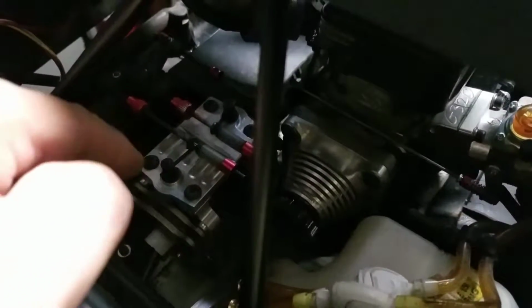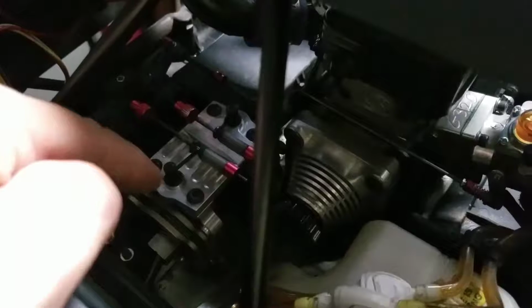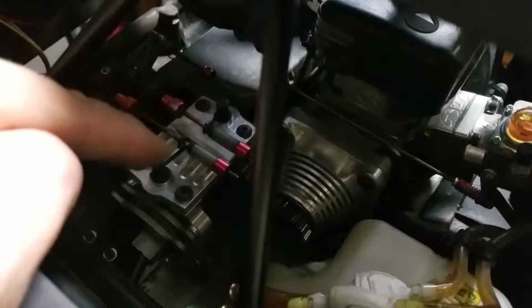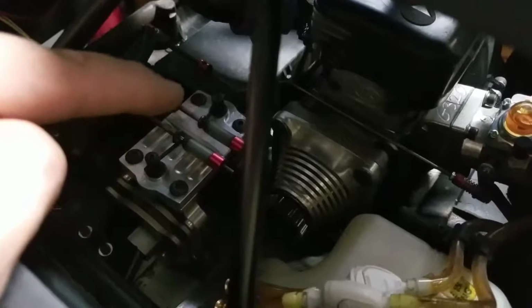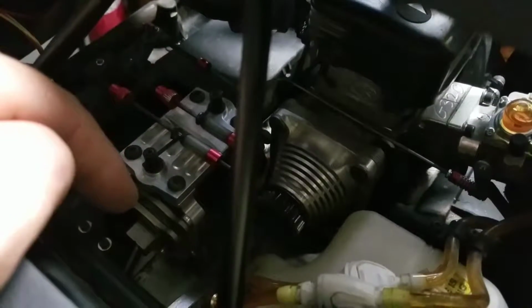In the factory setup, it would work fine, but mind you, these components are made for a Losi 5, Losi parts, not KM parts. And they base all of their design specs off of Losi parts. That's why aftermarket parts are said to be made for the Losi 5 and, in some respects, sometimes not for the KM chassis. The reason, I found, is that some of the critical components, like in the previous video the diff pinions, were of different tolerance than the Losi stuff. So the brake cams here wouldn't fit in this modified center diff housing or the center diff mount.